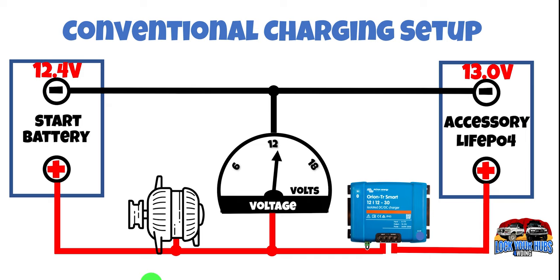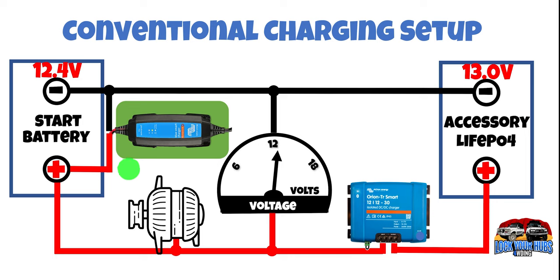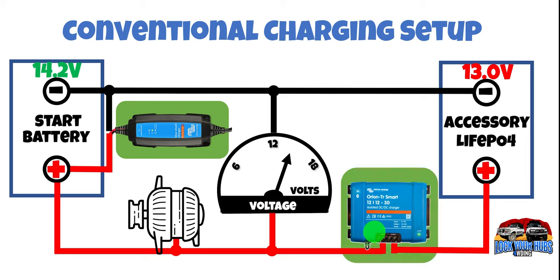Here's the first issue. Probably like me you don't drive your four-wheel drive every single day — it might be a weekend machine. So you might need to keep your start battery topped up with either an AC charger or maybe even solar. So let's put an AC charger on there — that's a Victron 1.1 amp, which is more than enough to keep your start battery topped up. It increases the voltage to your battery to 14.2 volts as it's charging. The problem is the DC-DC charger sees this increase in voltage above its threshold and turns on, so it starts charging your accessory batteries as well. You might think — beauty, get the two for one deal there!